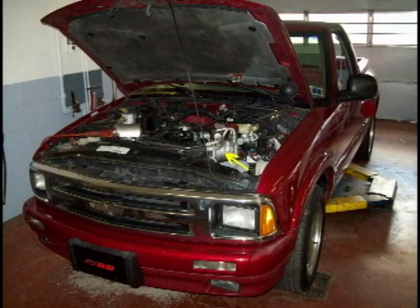I'm almost finished here. I need to put my air conditioning compressor back, which is shown here by the arrow. I didn't have to drain the Freon, remove the Freon. I just had to pull that air conditioning compressor aside. Now all I need to do is put all the fluids back in it, the oil and the antifreeze, and check for leaks and put the fan belt back on and road test it, and hopefully everything will be okay.